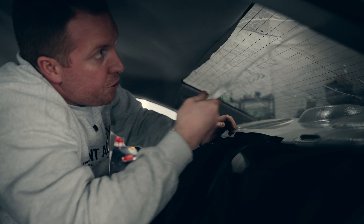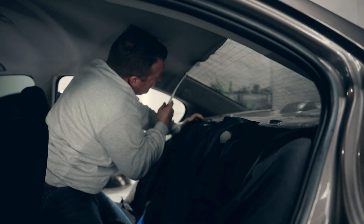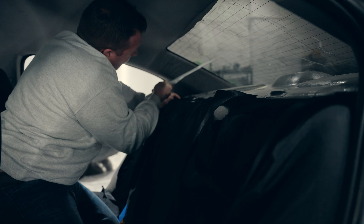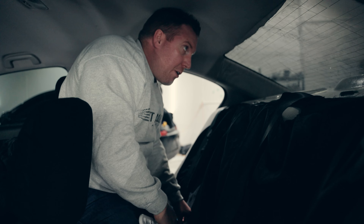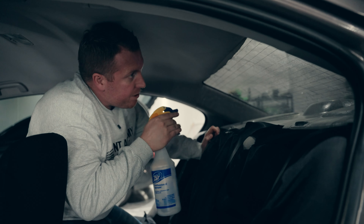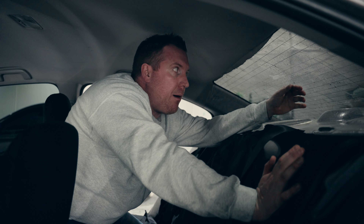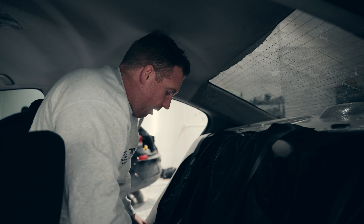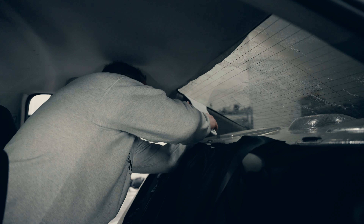I'm going to follow the same way that I shrunk this piece of film, and then come straight up this way. We're doing this very, very lightly. Once I do my hard squeegee, I'm going to spray down my film one more time. With my hard squeegee, we're actually going to follow the heat lines. If I go over top of them like a speed bump, we can move air, which can cause a little bit of peanuts. So when I do my hard squeegee, I'm going to follow this exact line, pushing all that excess slip solution out.